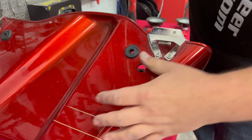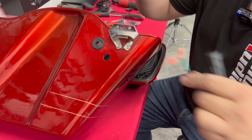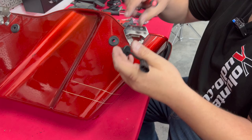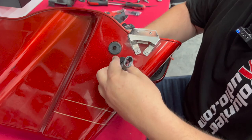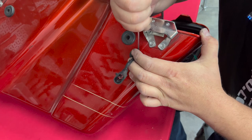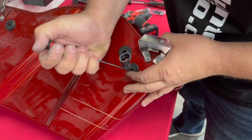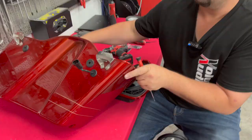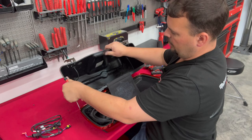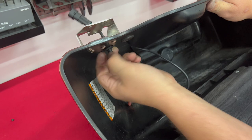We're right through. Now we're going to take our speaker wires — this is the left side of the bike so it's going to be our green wires. Depending on the kit you've bought, some will say clutch side, brake side, or belt side. It's going to be a pretty tight fit, so I'm going to use a small screwdriver to start pushing in the edge of this rubber grommet. As you get it in, it gets a little easier, but it's tight at the beginning. We want this to be tight because we don't want to let water into the bag from the hole we just drilled. Work your way all the way around pushing that in.